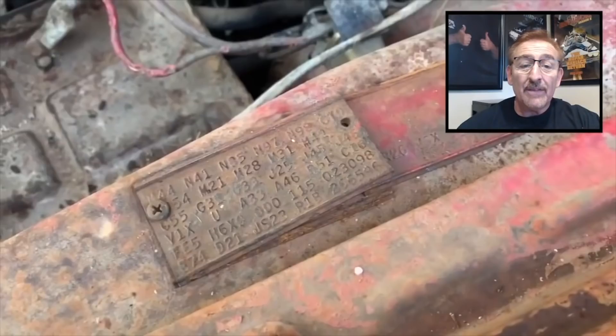There is something on this car on the outside that has been changed and isn't warranted on the fender tag. In the top row, just past the middle, you'll see N97 and N98 — that's a noise reduction package. This car should not have through-the-pan exhaust tips; it should have turn-downs because of the noise reduction package.